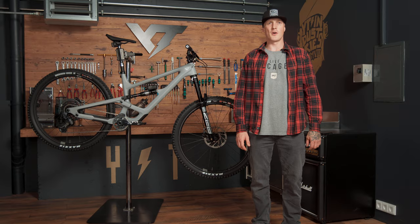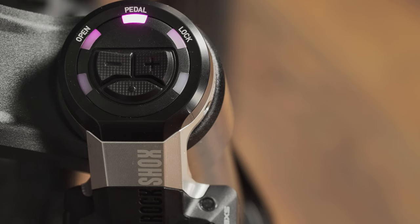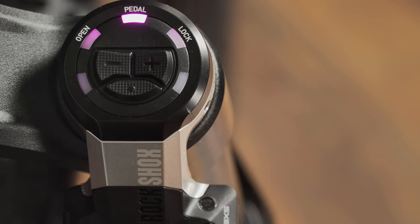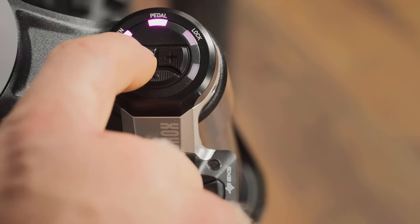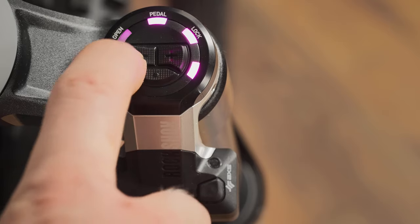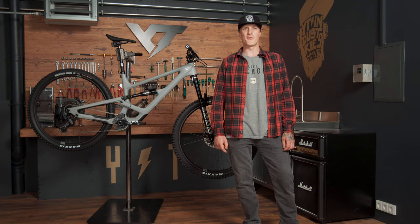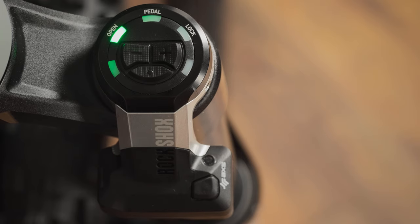With bias adjust, we can fine-tune our suspension from plusher to harsher. The changes are applied to the auto mode suspension algorithm. To adjust bias, press and release the menu button one time until the LEDs turn magenta. By default, the system is set to zero bias for the most balanced setup, indicated by a magenta LED sitting in the middle of the control module. Depending on personal riding style, we can shift the system to the open — that's minus one and minus two — or lock, that's plus one and plus two positions. Depending on the bias offset, the system favors more the open or the lock position. There is no right or wrong here; it really depends on personal preferences and may need some time and testing to set it up perfectly for you. To exit bias adjustment, press and hold the menu button for two seconds, or just wait 10 seconds and the system will get back to auto mode.